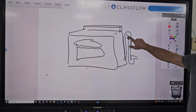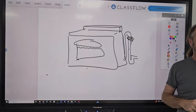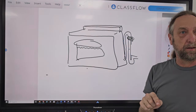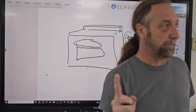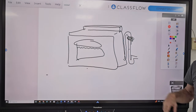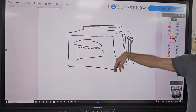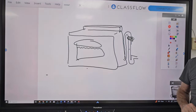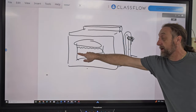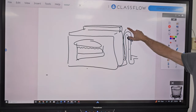So they take duct tape and they tape the pipe so that water don't leak out. But the problem is they create an air block. So what happens, especially if their pipe is starting to back up, the machine will fill up and wash the first cycle, no problem. When it gets to that half tub drain that we talked about earlier, where it's supposed to drain out to half the tub and stop, but if it's airtight here, I create a siphon.